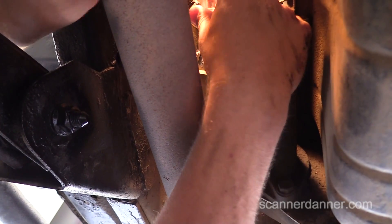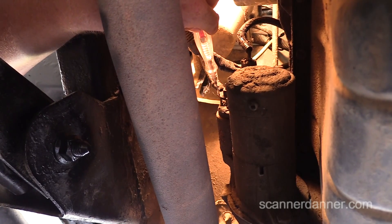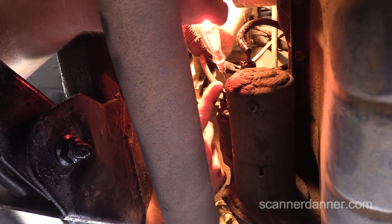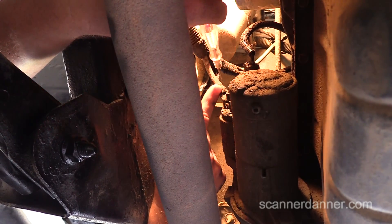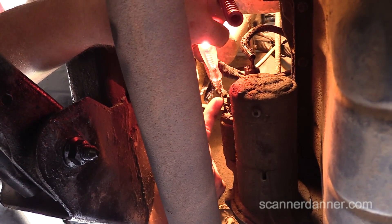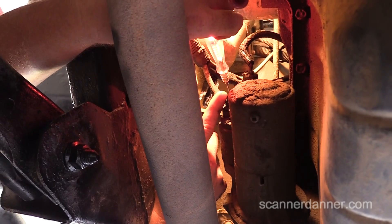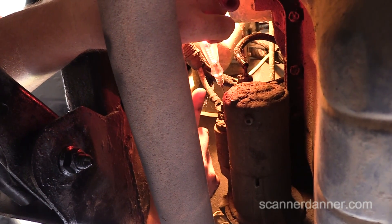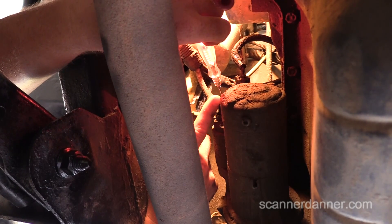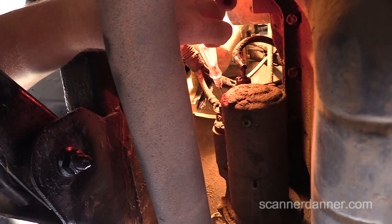Good feed, good control, good ground, bad starter motor. There's one last thing — as I'm promising you this needs a starter motor — when I did my check on the heavy wire, where you want to check is on the stud, not the eyelet. If you go on the eyelet, you could have good wiring there but I've seen many times that the contact is bad between the eyelet and the stud itself. The correct test is on the stud, done with it cranking. Make sure that light stays lit — and it does. It is possible to misdiagnose a starter if you measure at the eyelet instead of the stud because of a contact problem. So 100% at this point, we need a starter.